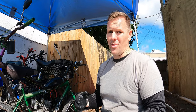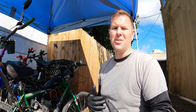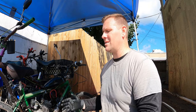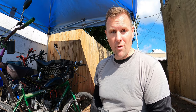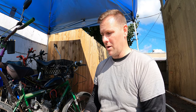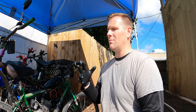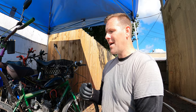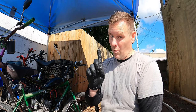Stock. When you go through it, fix the port timings, fix the freeporting issue with the exhaust, and a bunch of other little things, and just give it a once over, a good cleaning with the ports and all this, they're performers. They are performers. They have great power, meaning great horsepower. They have great torque. It will pull you up a hill, no problems, with a smaller sprocket. The horsepower has no problem getting away from the light and just going. They are real workhorses. Very, very happy with it once it's ported.